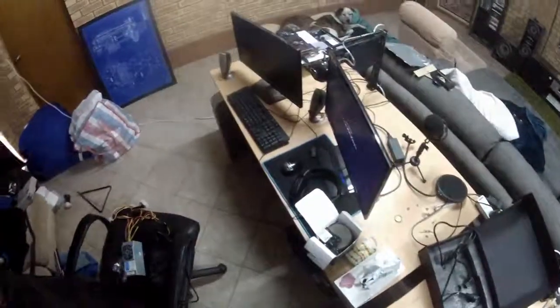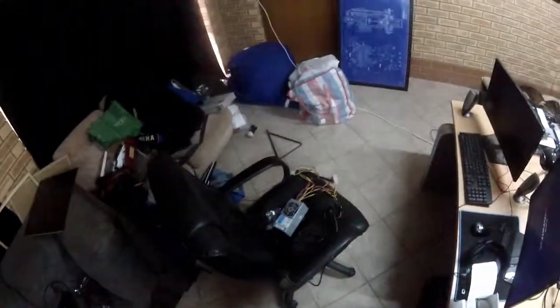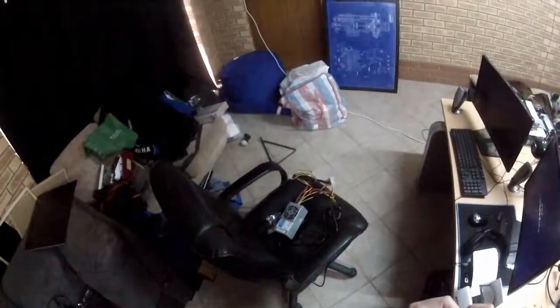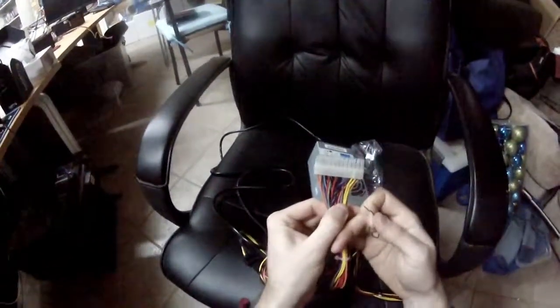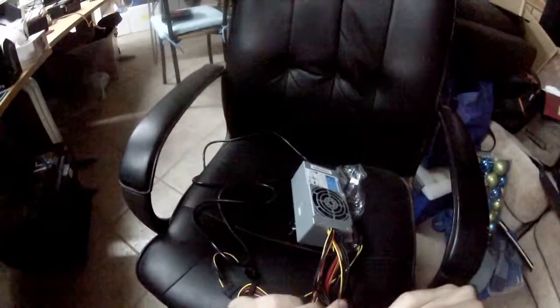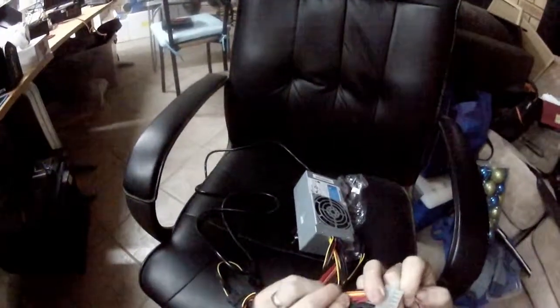Did some Googling, found out that a PSU won't turn on unless we've got a motherboard holding its hand, which I can't do. So in a move that's dodgy even for me, it says to jump 2 of the pins in the motherboard 24-pin connector on the PSU, the green earth and any one of the black neutrals. I'll just do the 2 next to each other, which apparently tricks it into thinking it's getting its hand held.